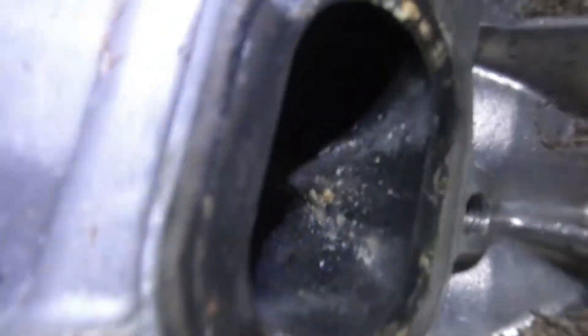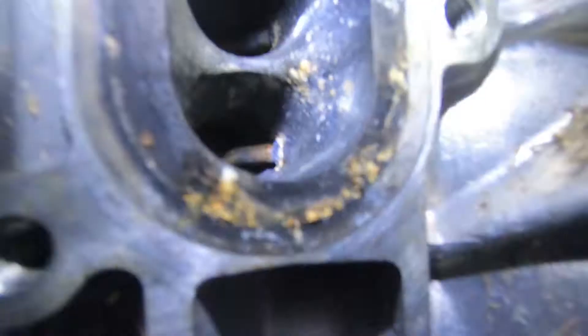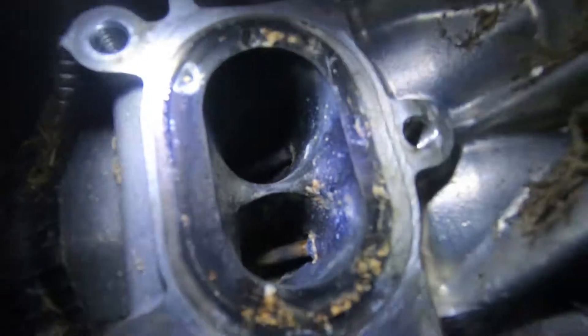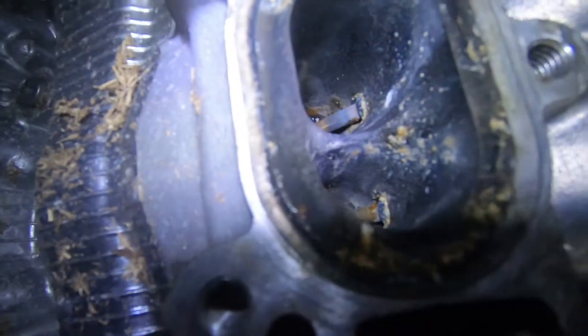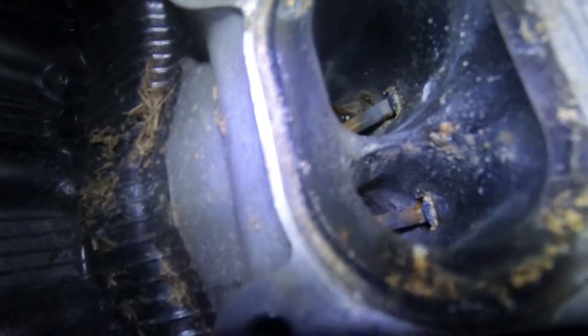Let's go down here and listen. You can hear that - it's leaking out of the exhaust valves here. So that is a good thing because I was afraid it was a bent rod or something. It looked like they were sealing, but apparently they're leaking pretty bad. So it looks like we got an exhaust valve leak, which is much easier fix than a bent connecting rod.